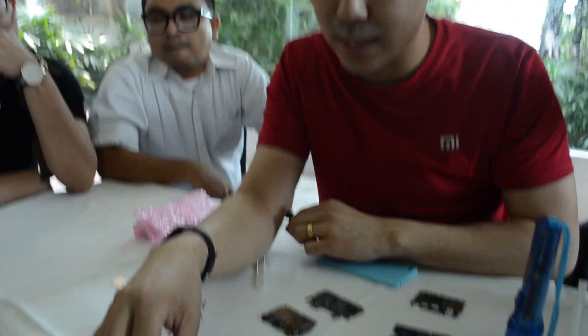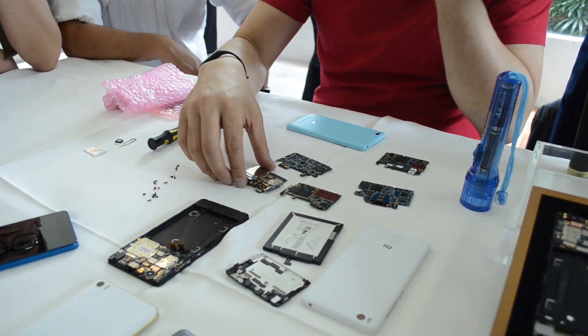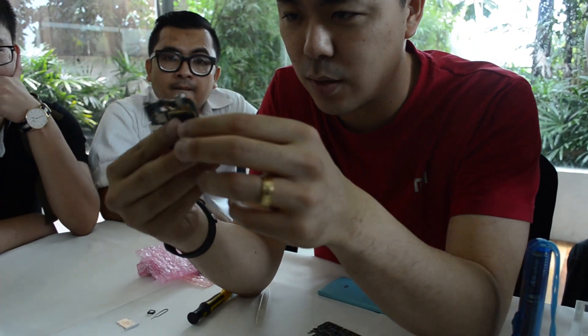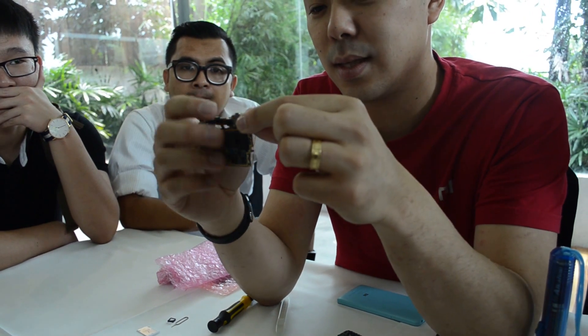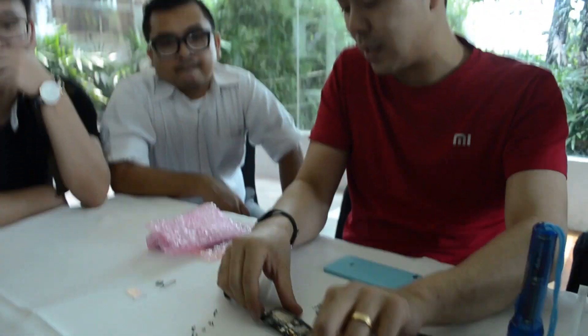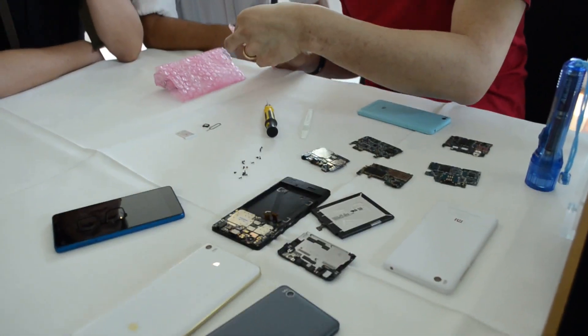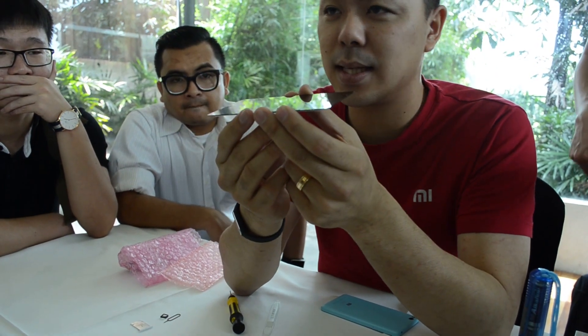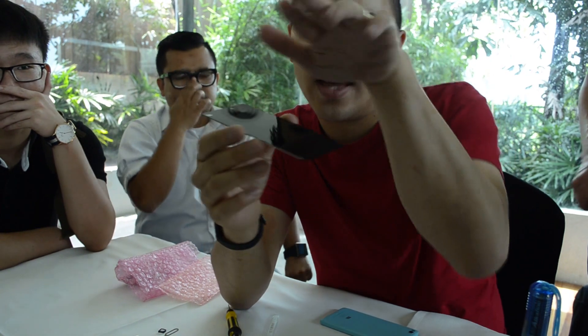I talked a little bit earlier about the camera, and I have another board here that still has the camera attached. You can see the little wings on the side that basically let it hook in — so you don't need any extra padding on the top or bottom, which makes it very, very thin. Speaking of making it very thin, this battery is pretty thin, and the display is also quite thin. So we talked earlier about the fully laminated 1080p OGS display — one glass solution. What does that mean? It means it's literally just one layer, where a typical display has at least four layers: the protective glass on top, two layers of the touchscreen panel for the X and Y axis, then an air gap, and then the LCD display in the back.